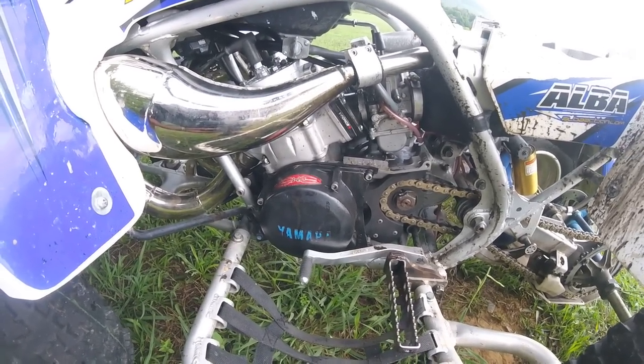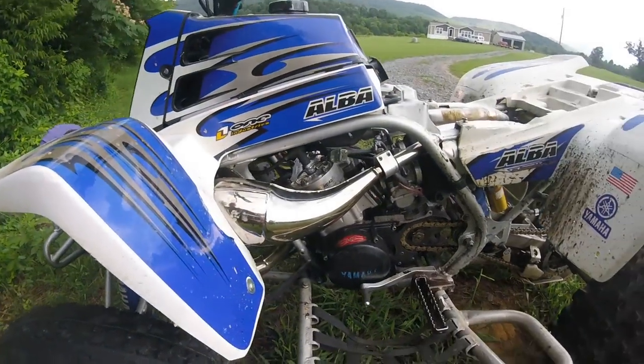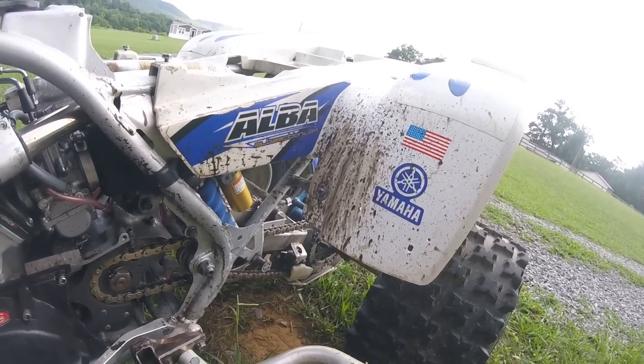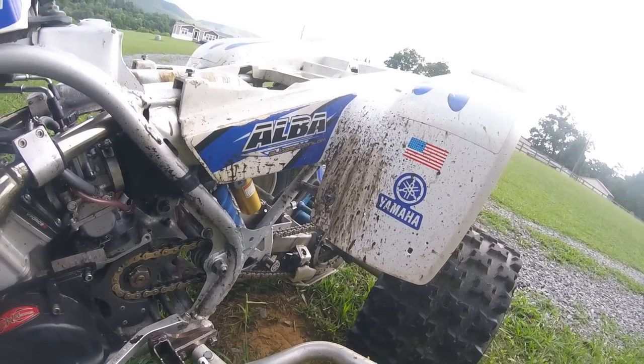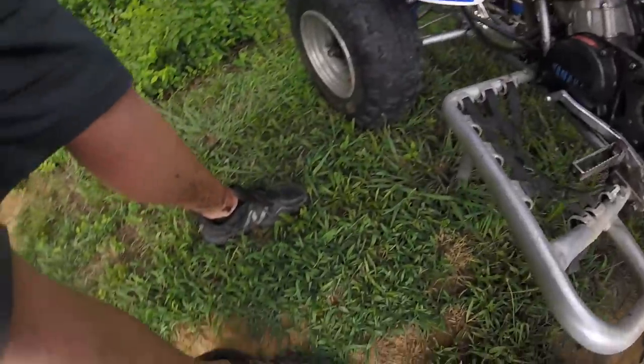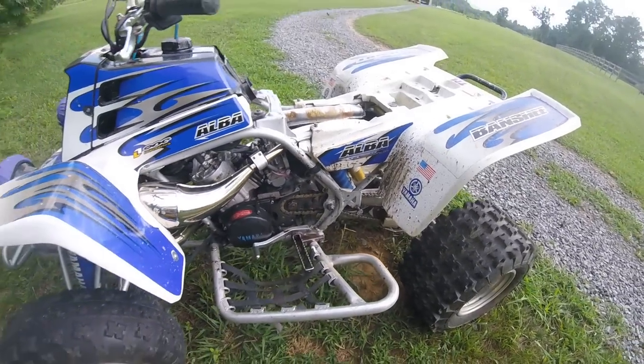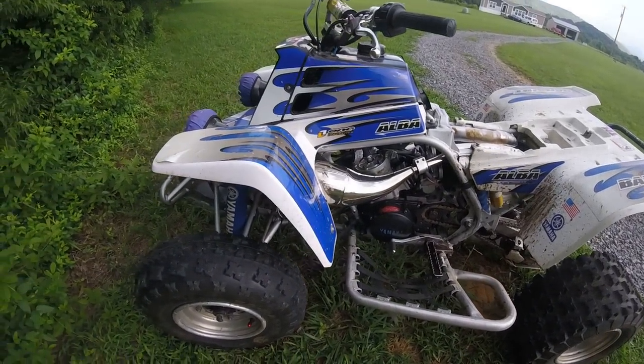I mean, you know, keep putting some comments what you guys like. Like I said, you see a lot of oil coming out, but that's because I tried mixing it 20-1 to see how it would do. Check this out. It's all over my legs too. But yeah, it's a little too rich, so I've leaned it back up. No big deal.